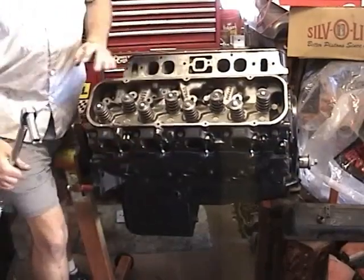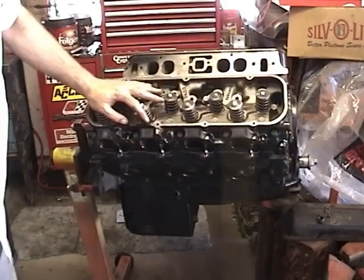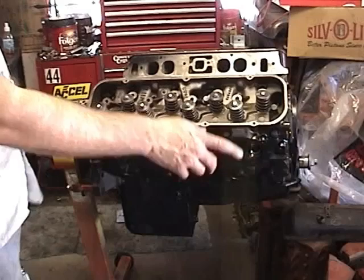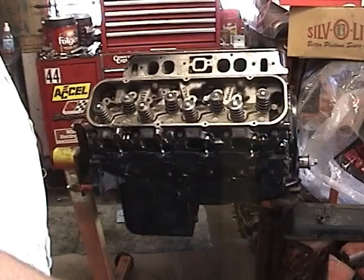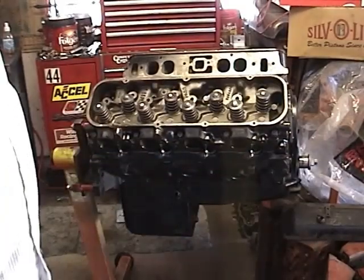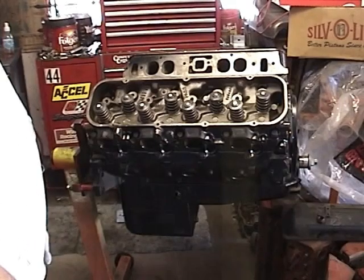Alright, and that's it. We've got our cylinder head fully torqued and double checked — it's done right. I'm going to turn this engine around, go ahead and tighten the head on the other side. Then we're going to put the push rods, rocker arm studs, and the rocker arms on and adjust all the valves. This is a hydraulic lifter system, so there'll be no valve lash. We're going to go ahead and do that stuff next.